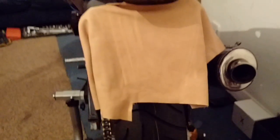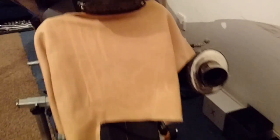I've also fitted the rear light — that's the rear light there. Unfortunately it's a little bit too wide to go on the mounting for the original rear light, so I had to make a little cutout from aluminium, drill it and fit it like that. It doesn't look so good because it's slightly off to one side compared to the number plate, which looks a bit stupid.